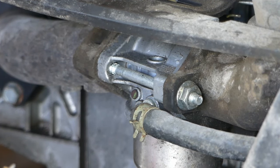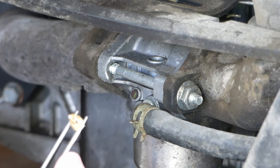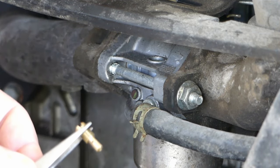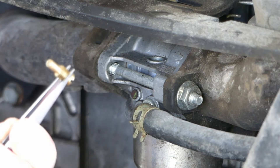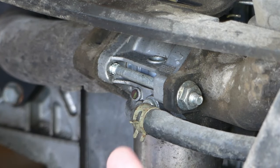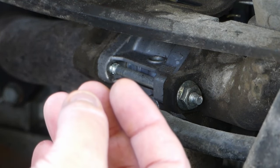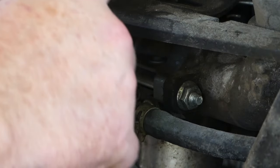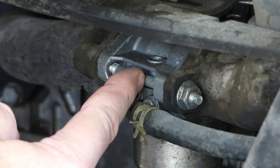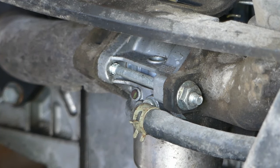There we go — right there is our jet. If the camera's picking that up, you can see that tiny little hole in there. Here are some little inlets. Fuel gets dumped into here, sprays out into the throat of the carburetor. The fuel mist will then mix with the oxygen coming in from here through the carburetor, go into the engine intake, get compressed, and then combust. That's how it goes.